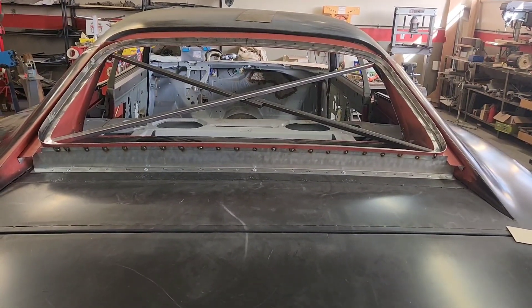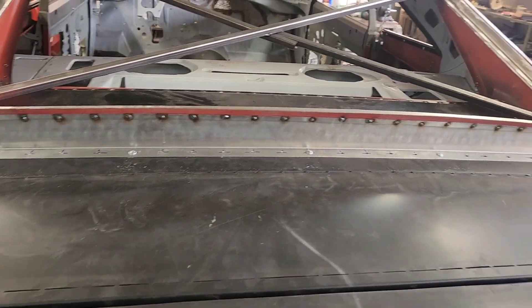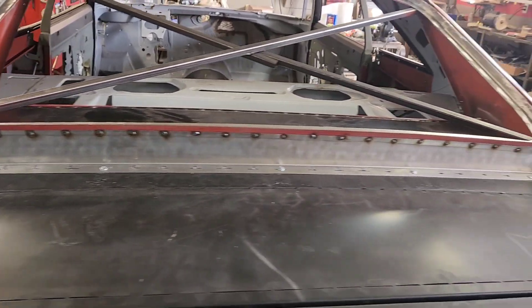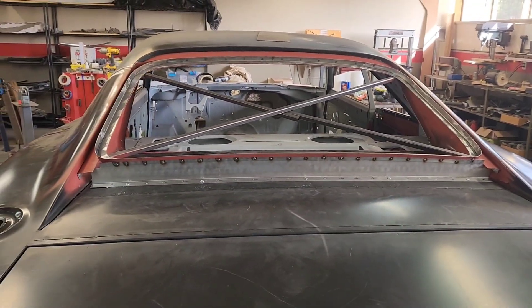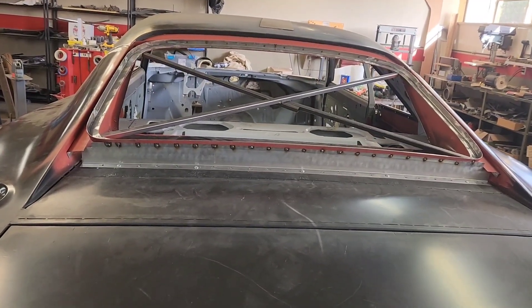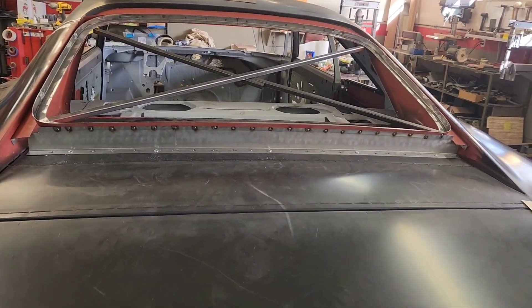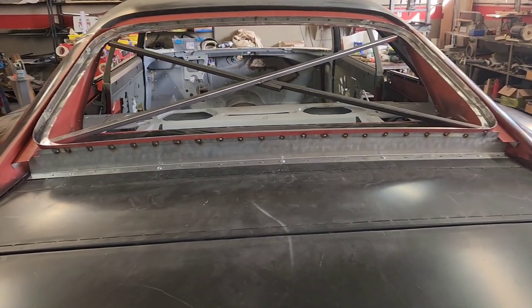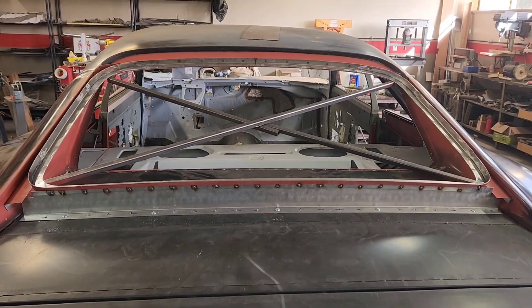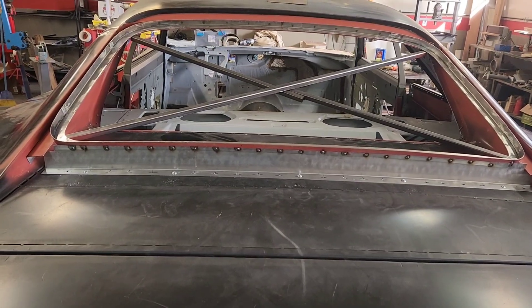Here's the base piece - it's just screwed to the car right now but it's welded to the window track to keep the window track curve from flattening out. The next thing I have to do is fit the window in and make sure everything looks good and is consistent - it's not rocking up and down in one corner or the other, since sometimes these things will get twisted.